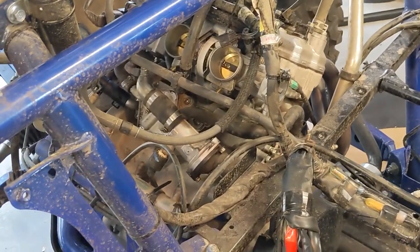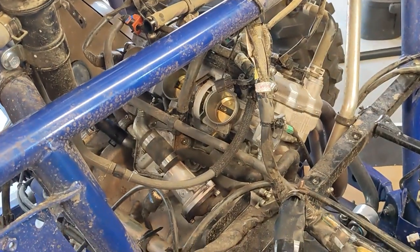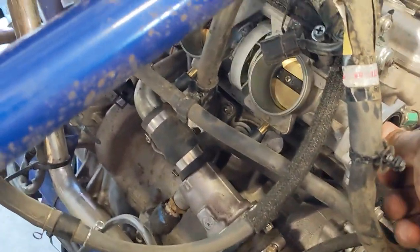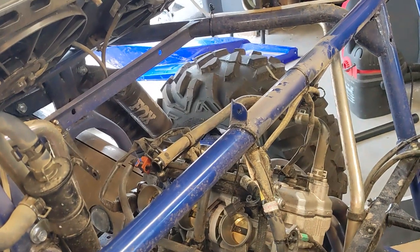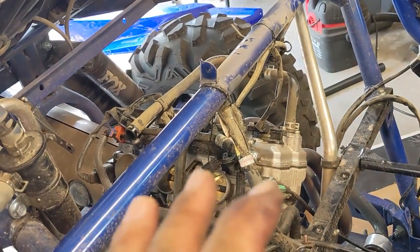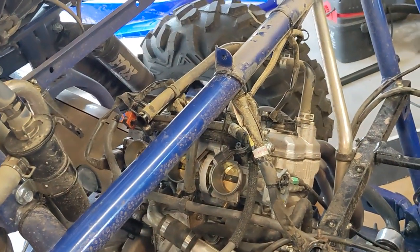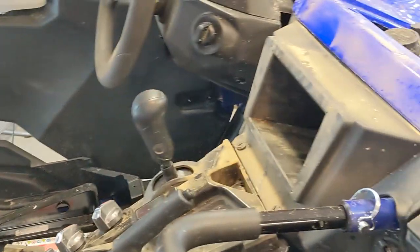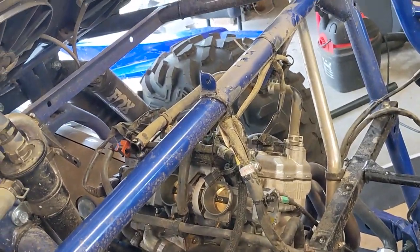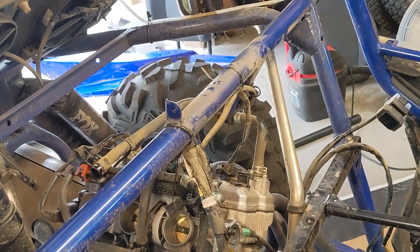If I keep this long enough for the water pump to go bad, it'll be a miracle. I also went through and lubed up everything in here and it's operating a thousand times smoother now — let it snap shut and it doesn't bind at all. I think I have fixed my throttle sticking issue by backing out those six screws that hold the butterflies, snapping it shut a few times, torquing back to spec, and then some lubrication in there should make this problem-free for the foreseeable future. The throttle cable is fine — I did spray some lubricant in there just to be safe, but it feels nice and smooth with a nice sheath, so I don't think that's going to be a problem.